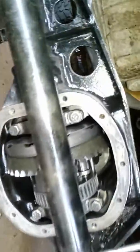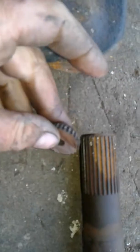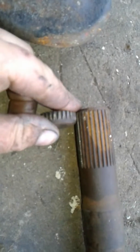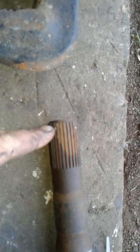Before I forget, one thing I had to modify to put that into a Jeep Dana 30 is shorten the driver's side axle. This is what I mean — there's your basic Dana 30 driver's side axle. To get the axle to push into the diff all the way and not hit the center pin, you take off three-eighths of an inch. That's off the old shaft, the one that's in the truck now. This one has to be cut, because I tried it, and with your hub and wheel bearing, it almost bottoms out but won't tighten up — because it's pushing the axle further into the diff than it's supposed to go, and that's hitting the center pin.